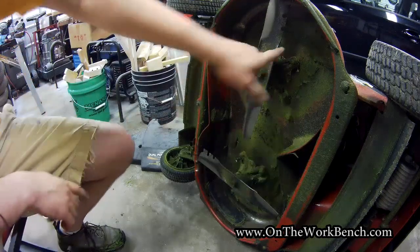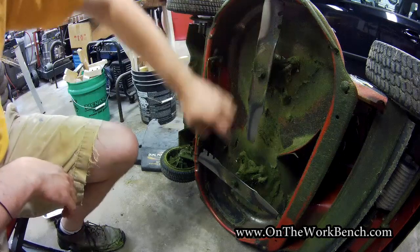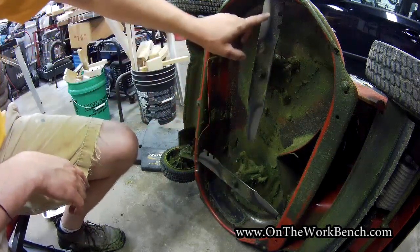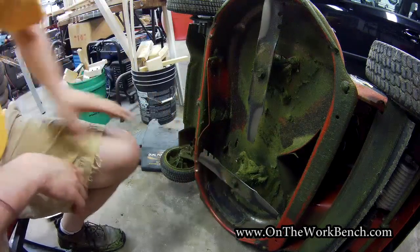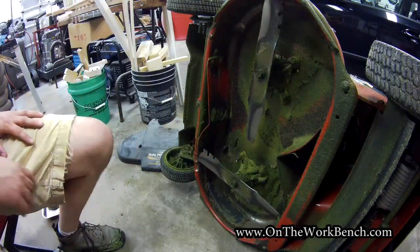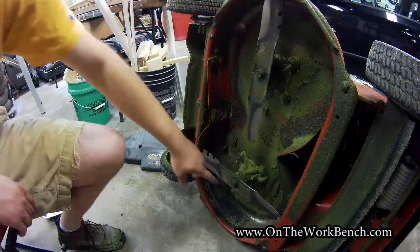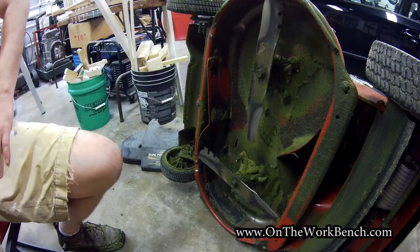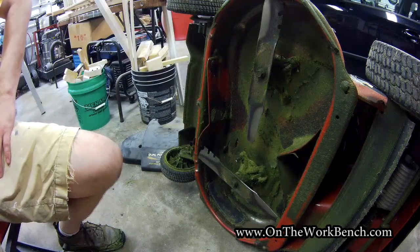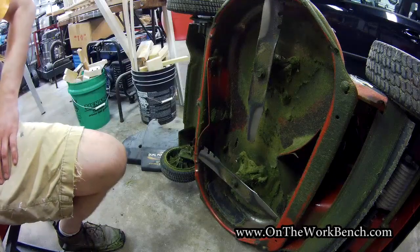With the mower on its side, we're going to want these blades approximately perpendicular to each other — when the drive blade is in one position, have the other one 90 degrees to it. I can hold that in place, and the blade brake is going to help hold it in the right position. Then we just wrap the belt around the other pulley. I'll go back on the other side of the mower to get the belt set up on the other pulley.